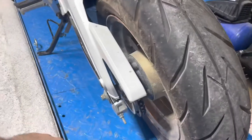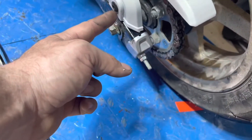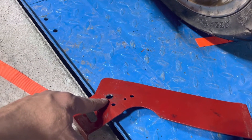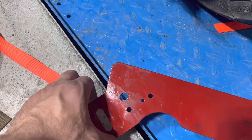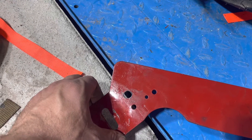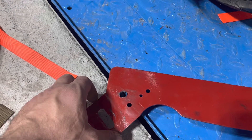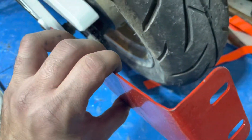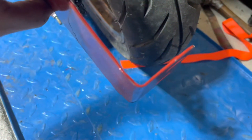After some additional testing I noticed the hole here that was covering the bolt for when I need to reattach this rear fender. I started drilling the hole and realized my drill bits aren't here — they're at work. So that's as big as I can go, and I was going to dremel it out, which is why it's kind of ovaled out. We're going to have to make it about an eighth of an inch all the way around bigger, so I'll probably go with 3/16 or something. I also need to do some more bending to get it to sit right — I need it to come over there and then bend that forward a bit.